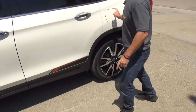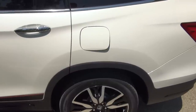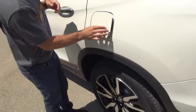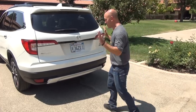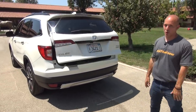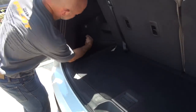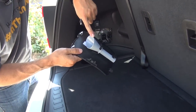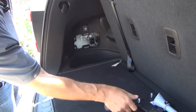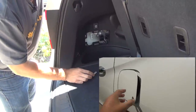Coming around to the side, let me show you a neat little tip and trick on the gas door. There's a button here that you press to open the gas door — everyone knows that. But what happens if something happens to that button? What if you lose power and need to put gas in the car? This gives me a perfect opportunity to show you the hands-free tailgate. No hands — step back and the tailgate automatically opens up. You take the key, separate it from the key fob, and use it as a tool. Open this little panel inside, and you have a manual trigger — when you pull on it with your fingers, it opens the gas door manually.